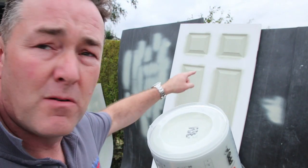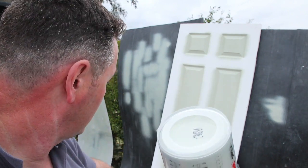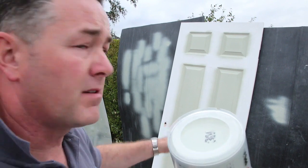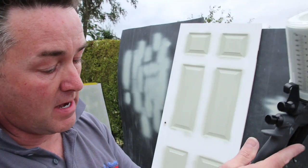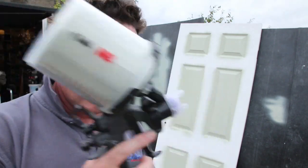It's not bad. Obviously once you get into your spraying, don't forget your 50-50 overlap. Don't want to be putting too much paint on that it runs. It's a nice panel. I've done five panels. I've probably sprayed a bit too quick, moving a bit too quick. But the paint's quite thin - I've thinned it down. You can always just dial it in so you're not putting too much paint on. Slow down so you don't get any misses. But don't forget this is undercoat - I'm quite happy with that.